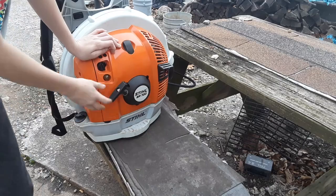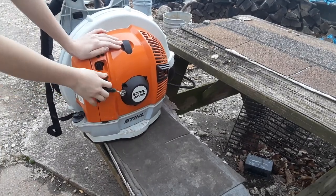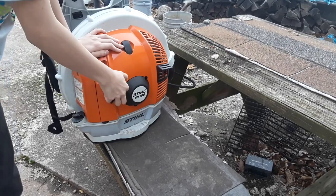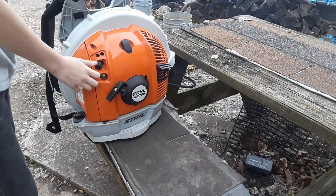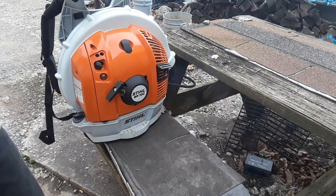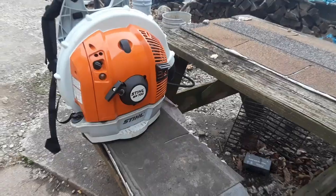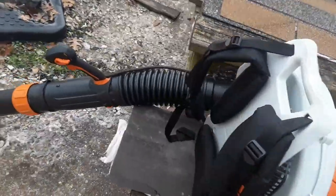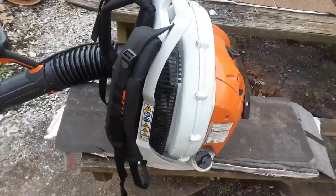The spark plug is under here. The fuel ratio is 50 to 1, and if you buy the six-pack of oil — which I did — you get a six-year limited warranty. Now I'm going to show you how to start it: turn the on-off switch, which pops back into place after you use it, so you don't have to worry about leaving the kill switch on. Turn the choke on, prime it a couple of times — mine's warm already — and just like that, it starts.